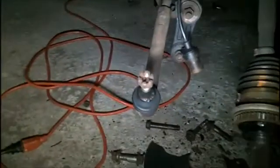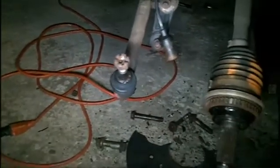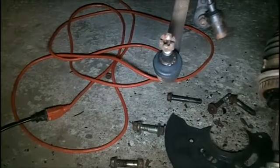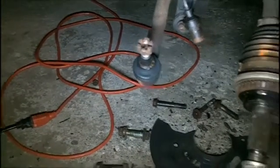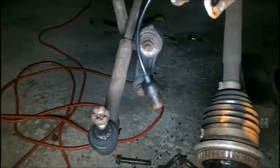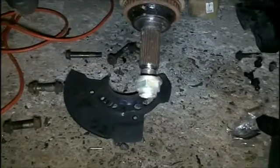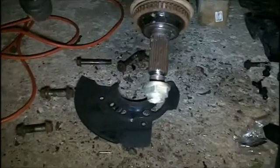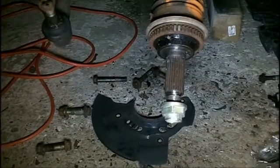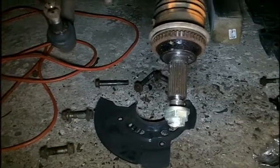if it was. So then I went down to the tie rod, and there's a cotter pin in there, so you have to punch that out and then loosen that nut. So I did that. Next I took out the ABS sensor. That was a neat little trick. And then of course I took off the axle nut. That's the 32 millimeter impact socket that I had. That came out like a champ with the electric impact wrench.